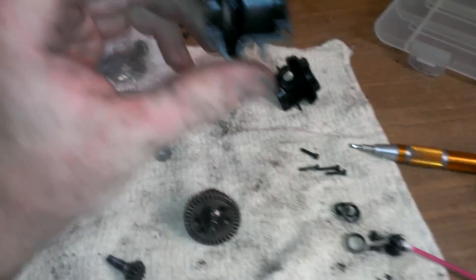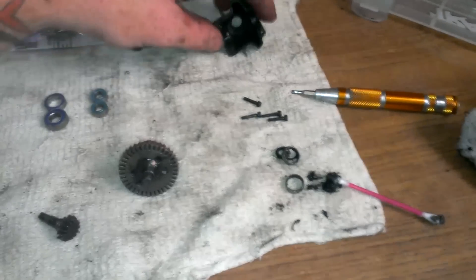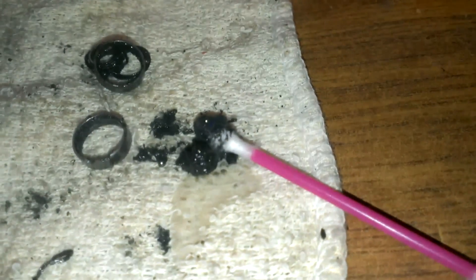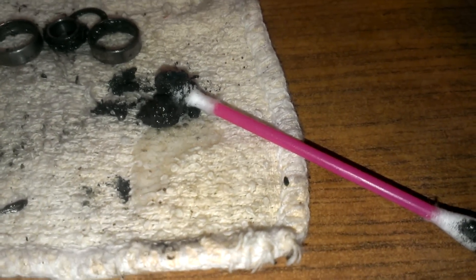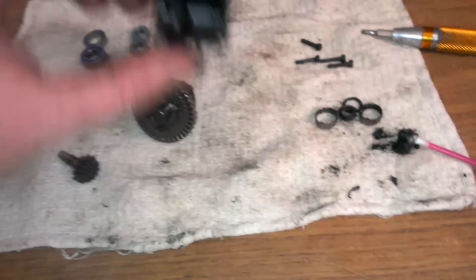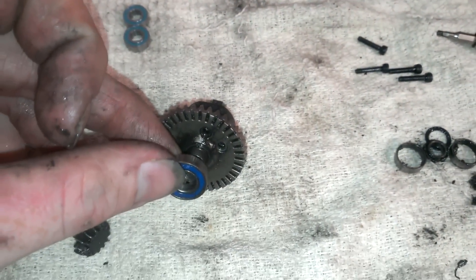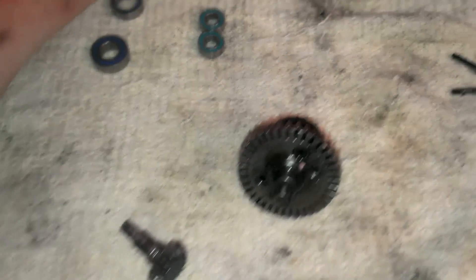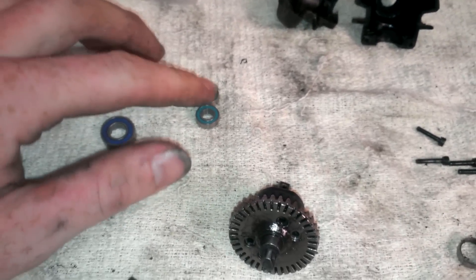I went ahead and cleaned these up. Here's all the crud that came out of there. The front bearing — this was the one that was on the inside, and this was the front one. As soon as I pulled it out it just fell apart. I use a Q-tip to get down inside and get all the junk out, including all the little ball bearings. The bearings that go on the side are still good — I just replaced these last time. It's these inner bearings that are the problem. I believe they are 5x12s — I'll put what they are in the description.